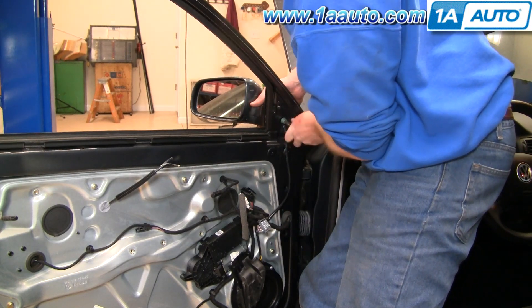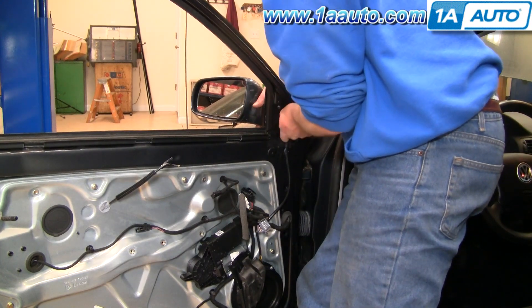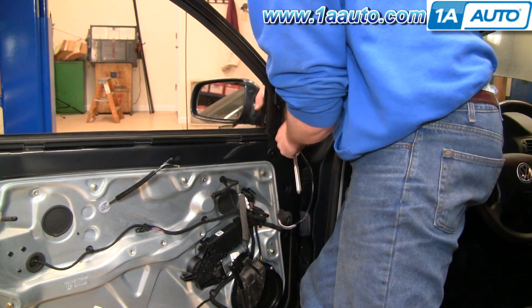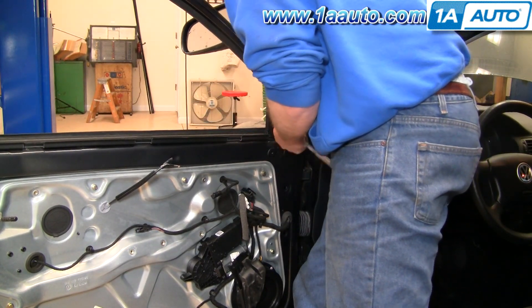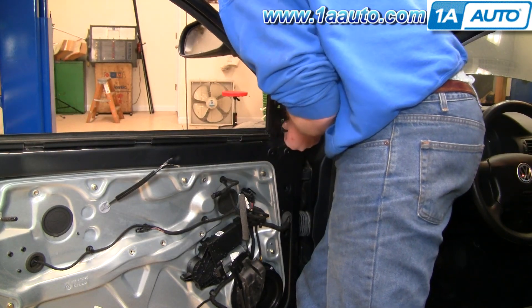As you can see, I stood up to get a little extra leverage. I'm going to speed up as I remove that screw. Now the mirror comes out — feed the harness out carefully.